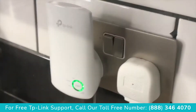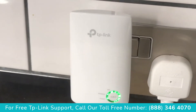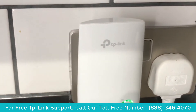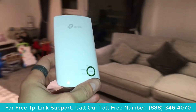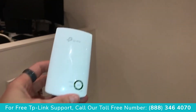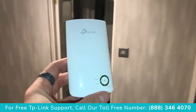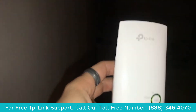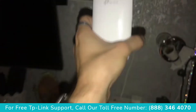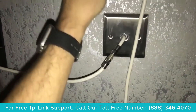On the front of this TP-Link, the aim is to have this unit as close as we can to the area of the house that has less signal, while also maintaining a strong signal from the router. The lights on the front of the TP-Link indicate your Wi-Fi strength — you're looking for three or more lights. If it's down to just one light, it's quite a weak signal and you should move it to a midpoint closer to the router.